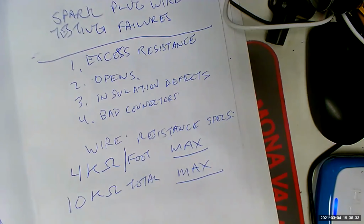That makes sense. And we saw that the longer the spark plug wire is, the more resistance it has, which stands to reason. It's a resistor wire. It's not just wire. Now, could you replace it with wire? Yeah, but you're going to hear it on your radio, that's for sure. And there wouldn't really be any benefit to it, because with that much voltage you can blow through all kinds of resistance. Current is not the issue.